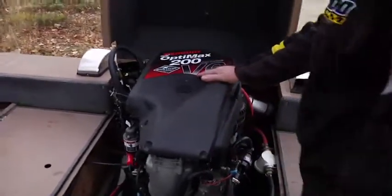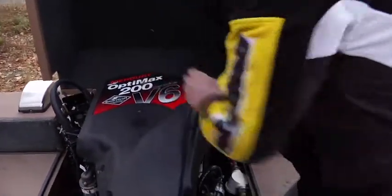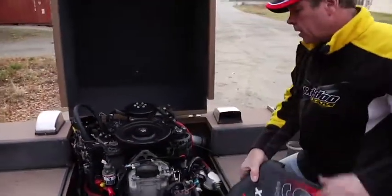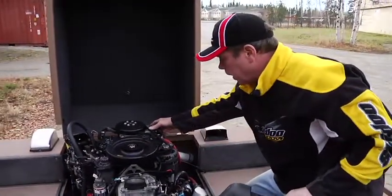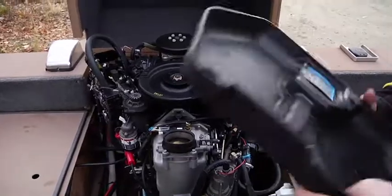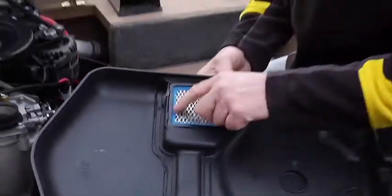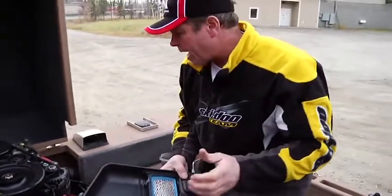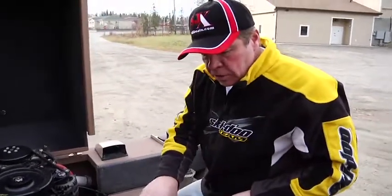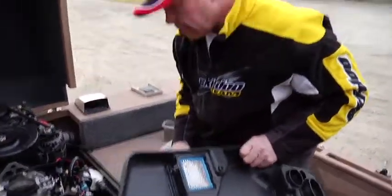This is your engine lid — very seldom do you have to get under it, but there's a bungee cord on the port side. Disconnect it, wiggle the lid straight up, and it exposes the flywheel, the alternator, your air handler system, and so forth. There are no carburetors since it's a direct-injected engine. There is a filter under here that feeds the air handler and the compressor. If you take it off and it's all black, that indicates a blown hose or similar issue. Mercury recommends changing this filter annually — it's inexpensive and pops right out.